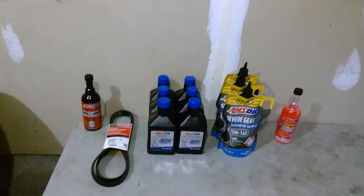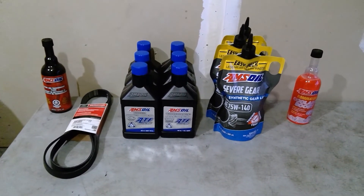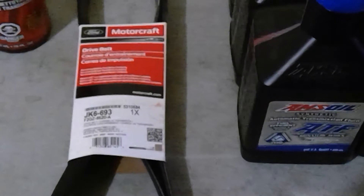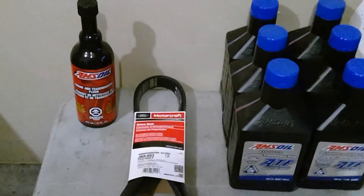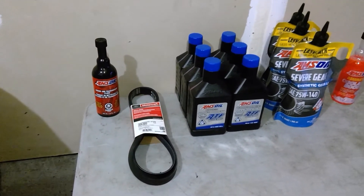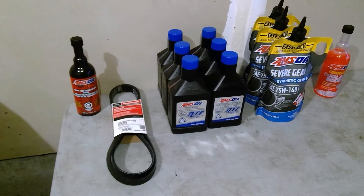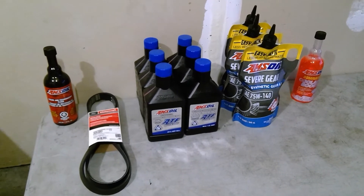So this is what's on the table. You don't have to do it, but if you practice good diligence and want to increase the availability of your CD4 chassis, I strongly recommend changing the serpentine belt. I'll zoom in on the part number so you know it was purchased at the dealership. Also, since you're there, I would strongly recommend draining your ATF fluid. You can go Motorcraft LV or get the ACDelco one — it's the same transmission that's in a lot of GMs, that six-speed transmission. You'll need about five to six quarts depending on the angle of your car.